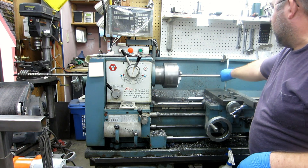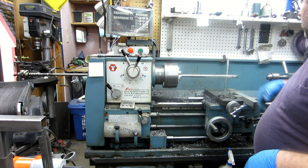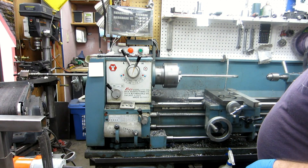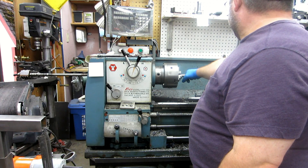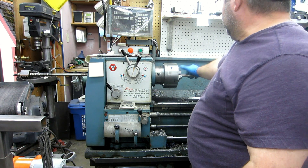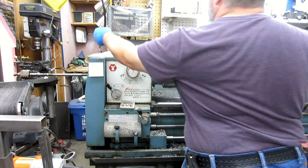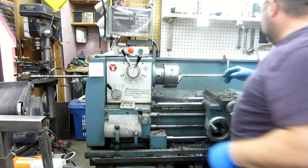That's not bad at all - I could live with 300 RPM. So I might just do that. I need to machine a butt connector and make sure I've got the metal for it. The DOM tubing that Morrison had over here the other day would be perfect. Let me undo this and feed it in from the other direction to see if I like that any better.